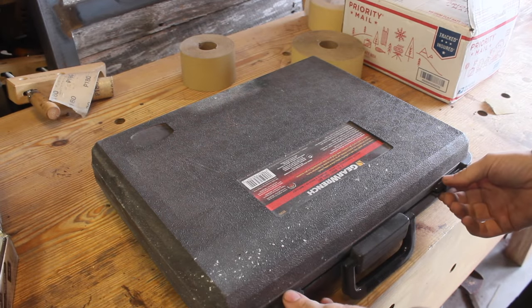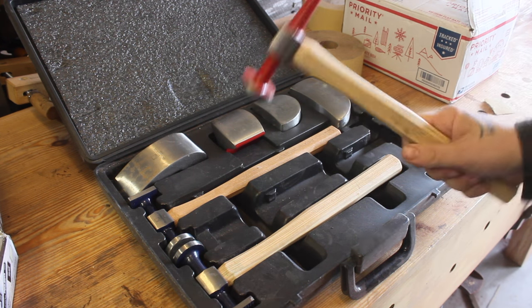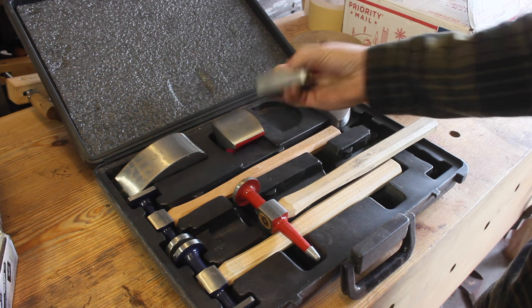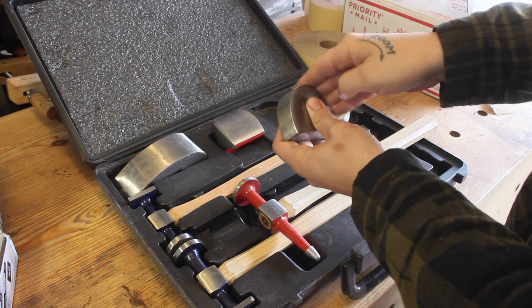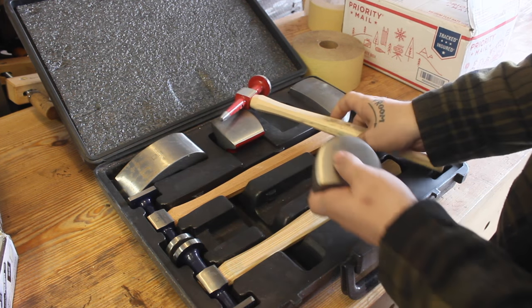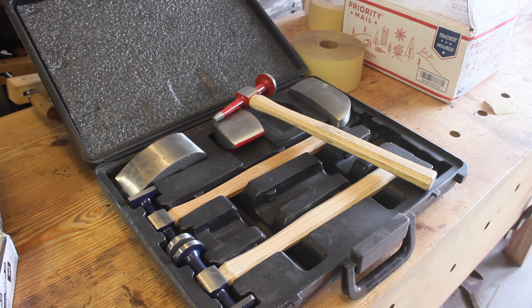The first thing you're gonna need is a set of hammers and dollies. I actually pretty much only use this one, though I do use all the dollies. This is kind of my go-to here. You wanna get one that has a contour that roughly matches the inside of what you're gonna be hammering against. This set's from Gear Wrench, I think it's $100. I'll put a link to it in the description.